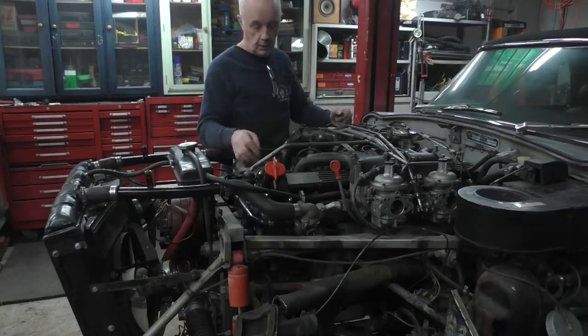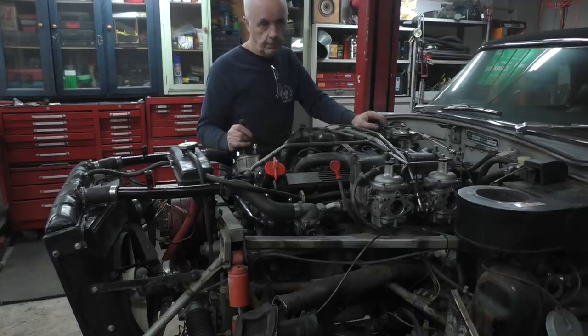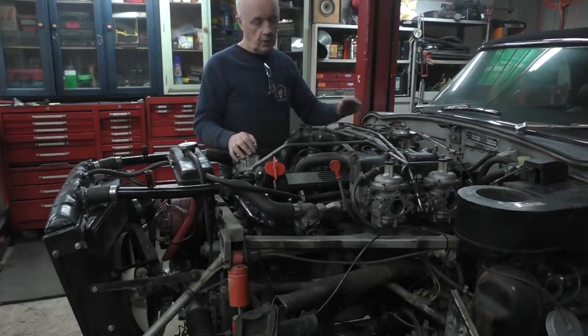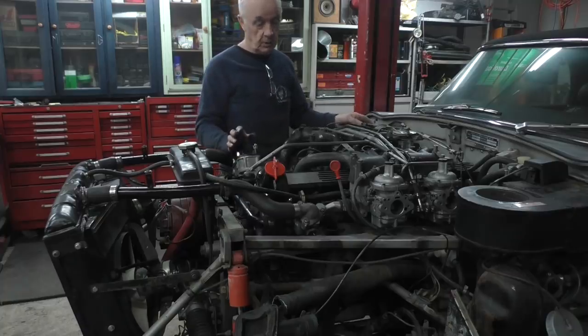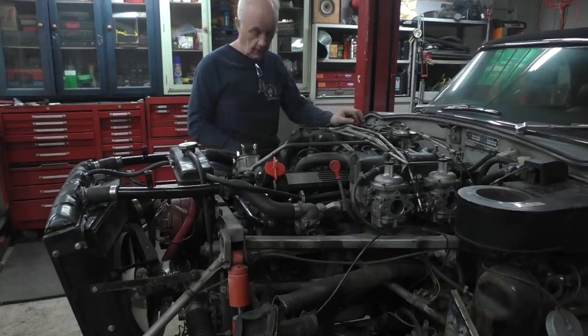I put oil in the engine, and I coupled up my mechanical gauge that you remember that I did on the loose engine. So I coupled that up, cranked over the engine until I got oil pressure, which I got 40 pounds again. Because if you bear in mind, I changed all the oil system, the pickup, everything. So to make sure that was kosher, I did it again. So I got 40 pounds there. So I was ready to start it up, which I have done.